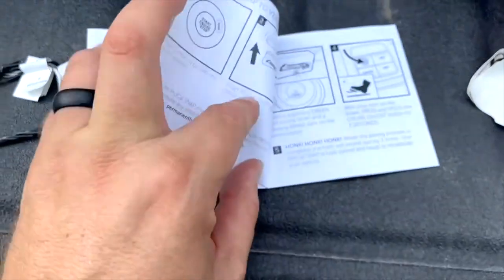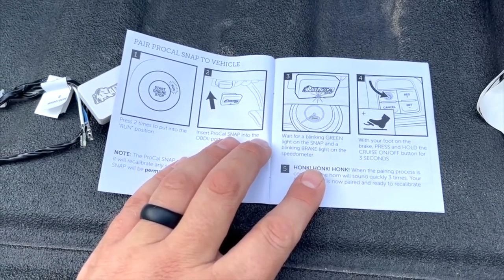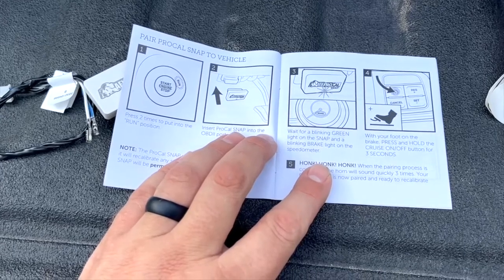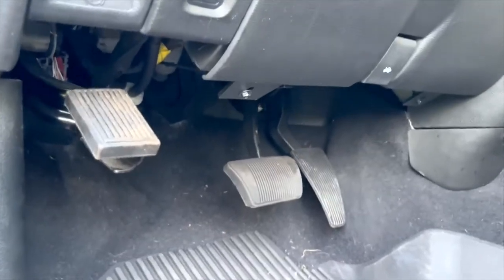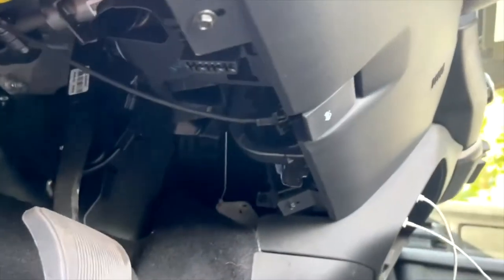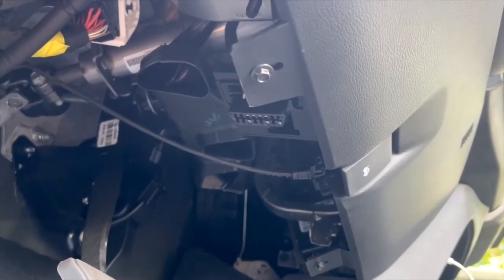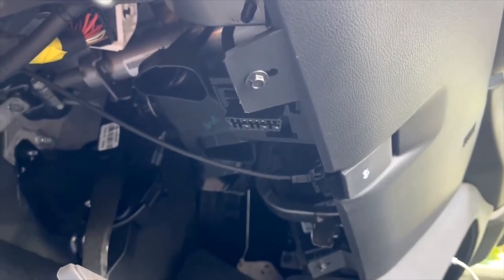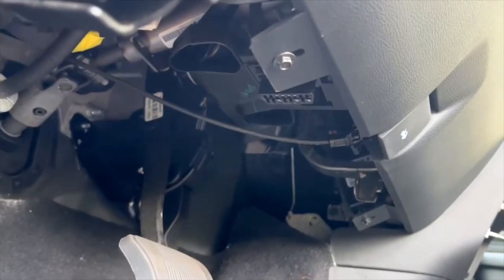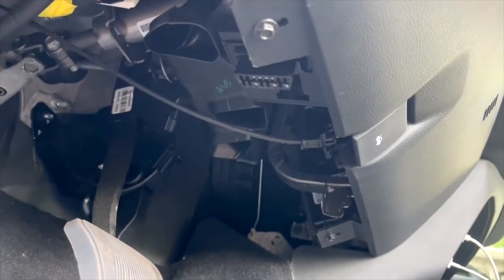Let's go ahead and take a look inside the truck and follow the programming and see if we can address the tire size and the air pressure issue. If you're not tracking, the actual OBD port is hidden right here, at least on my truck. What you have to do is go to AEV's website and get the install guide. You should take this out and use the wiring harness attached to actually pair the OBD to the ProCal Snap.